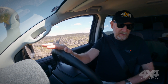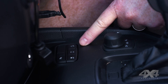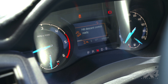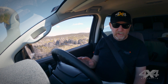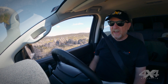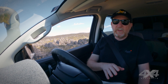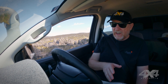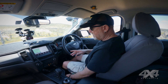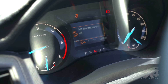There's one more device in this vehicle — hill descent control. If you hit this button, it shows 'hill descent control ready' on the dashboard. It uses the vehicle's ABS braking hardware and software to maintain a set speed regardless of gear. However, for a long descent it'll heat up the brakes and other mechanical components. For this particular descent, which is a short one, we don't really need it. I'm turning it off — I'm happy in low range first gear, and we're ready to roll.